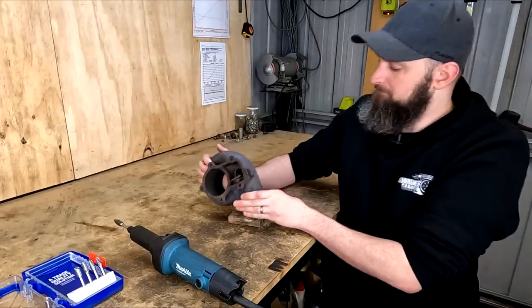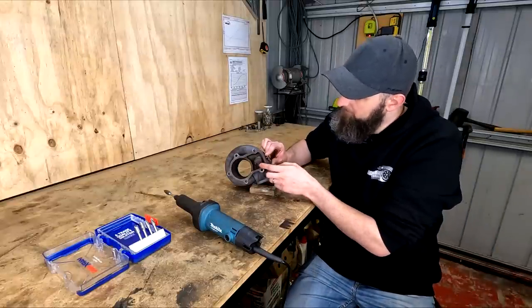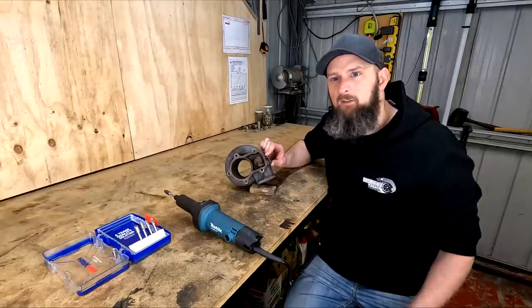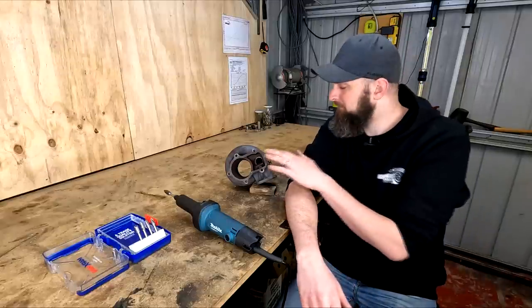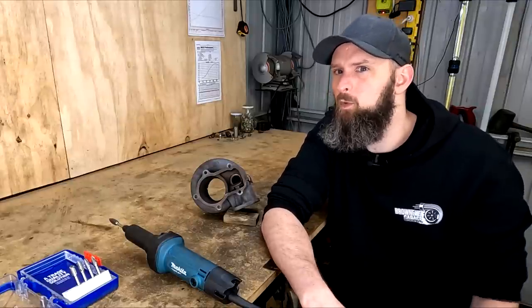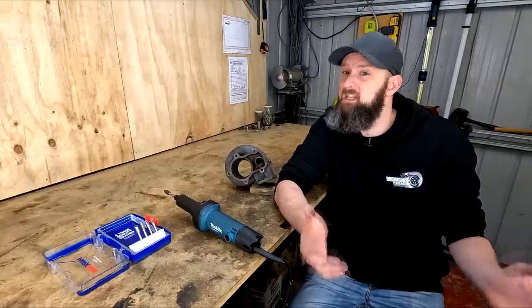The other benefit is that the Pulsar housing already comes with a larger flapper valve — 38 millimeter I believe, compared to the stock 33 millimeter — so it saves us cutting the old one off and welding a new one on. The port for the Pulsar should also already be slightly larger, but we'll be working on that more. I'm not sponsored by them but it's a nice looking product, they're getting a good reputation, and the customer support I've experienced was excellent.